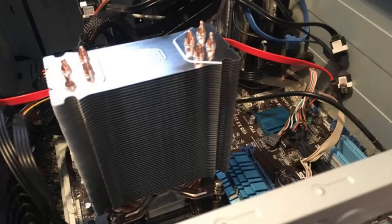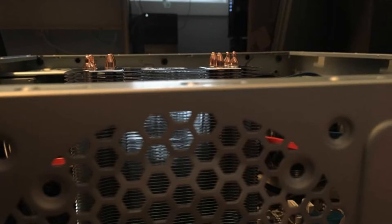I even went to a couple stores after and checked to see if they had any full-size ATX cases, but they're not wide enough. I measured close to 8 inches wide between the case to case because on the inside there's about an inch where there's usually a metal backing plate where the motherboard goes on to. So it's about 7.5 inches on the inside that you need in width for that fan not to hit the side of the case. Let me show you what we did.